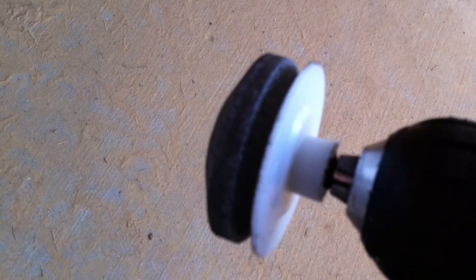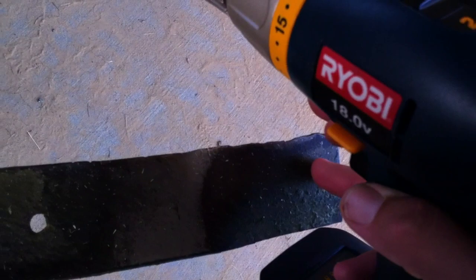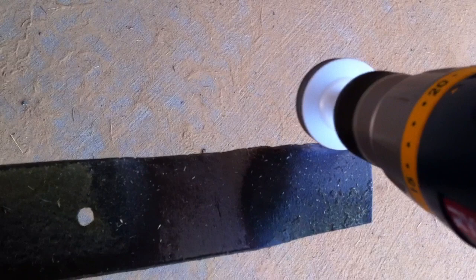Let's take our blade here — the cutting edge is on the underside. We're going to wedge it in between the white guard and the grindstone itself. You can see it's at an angle; the white backside is going to be flat against the back side of the blade. Then I'm just going to go along and sharpen it just like that.